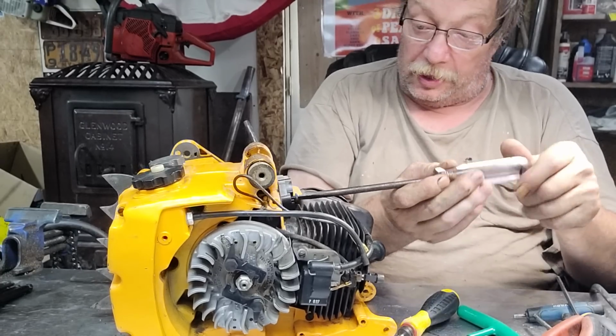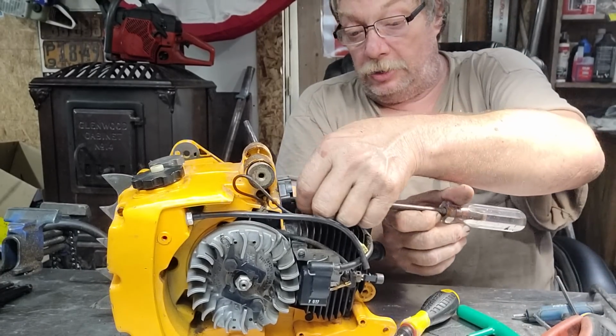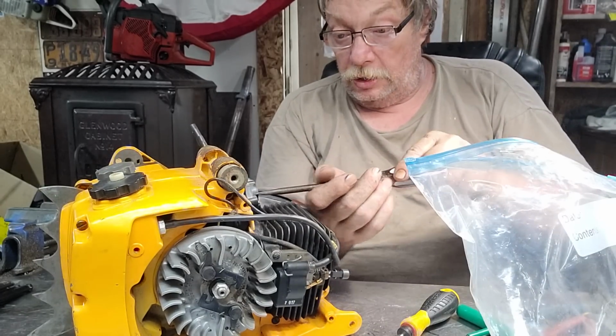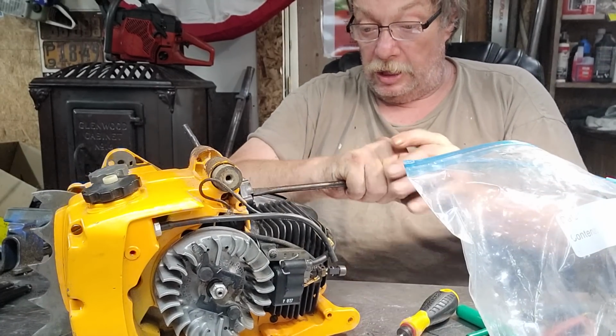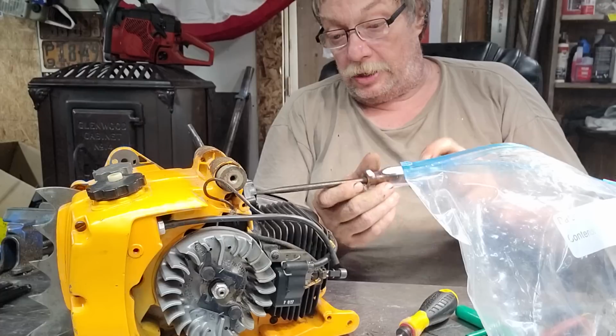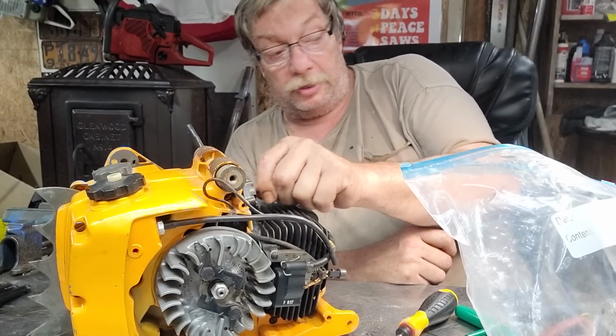Torque was perfect on that, Ben. Good job. You over tighten this reed block, over torque it, you won't like yourself. You'll bust it. If you don't bust it, put it in, the vibration and temperature changes will. You get it just right, and you're good to go.